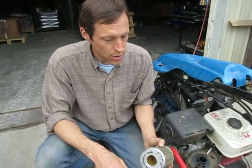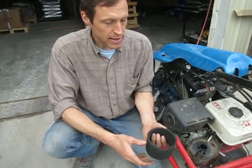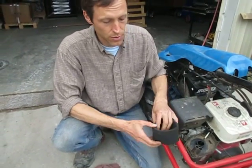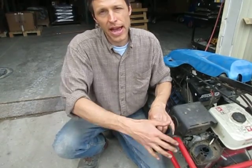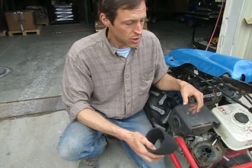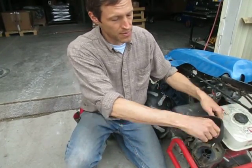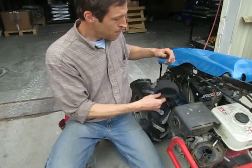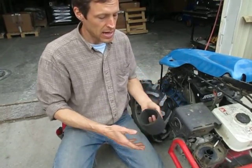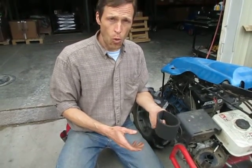This paper is pretty new, so I'm not going to replace it. Normally when you take this off, or even just pull the air cleaner cover off, you'll sometimes see as much as a quarter inch of dirt built up on the outside of the foam — and that's great, that means the foam is doing its job. So you would just slip the foam off; you don't even have to remove the paper. You can slip the foam off the outside and bang it on something to get the big dust off.